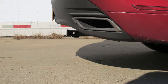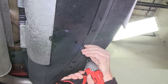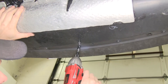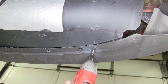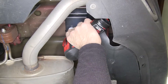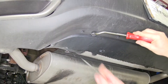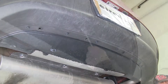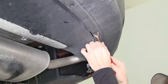Now we'll go ahead and show you how the hitch is installed. The first thing we need to do is go ahead and remove the lower body fascia. There will be 6 screws in the bottom edge of the bumper cover, and there will be 4 on the inside we have to remove. We're also going to remove 4 plastic clips. Sometimes it helps to take these clips off to have the plastic loosen up a little bit more.